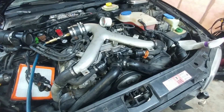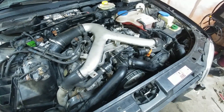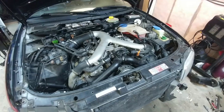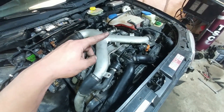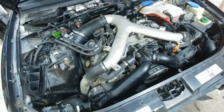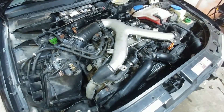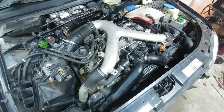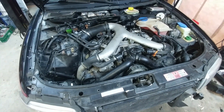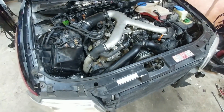We're also possibly going to put an exhaust on the car. Status update: fixed all the boost leaks, added the clamp, replaced the intercoolers. There is a small leak at the F-hose connection that I need to take one more look at - we might need a new F-hose. The remaining issue is misfires on cylinders 1 and 5. I've done new spark plugs - copper BKR 7s for the upcoming stage 2 tune - and switched around some coil packs. That didn't seem to help but as the car warmed up it started to have zero misfire counts, though the engine still seems like it's shaking at idle which makes me think it's still misfiring, possibly too fast for VCDS to read.